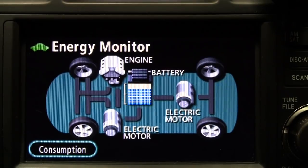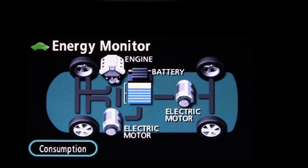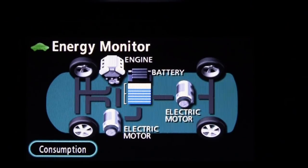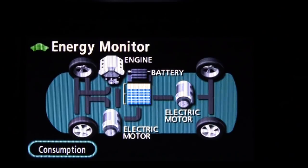The hybrid electric control system — the battery controller — tries to keep the battery from going below twenty percent or above eighty percent charge. By keeping it within that range and not doing full cycles, only partial cycles, the battery life will be longer and have more usable cycles.